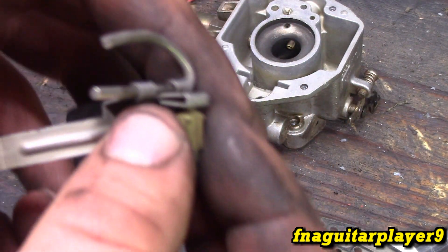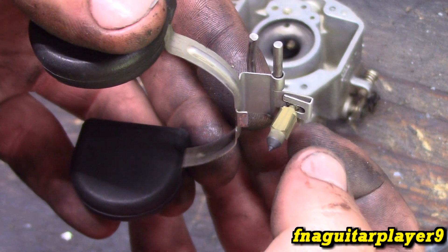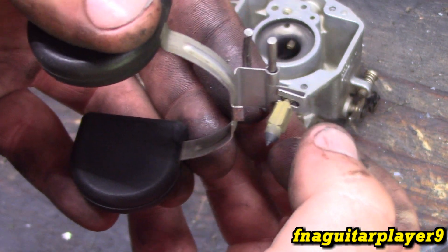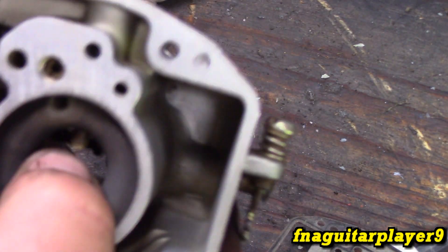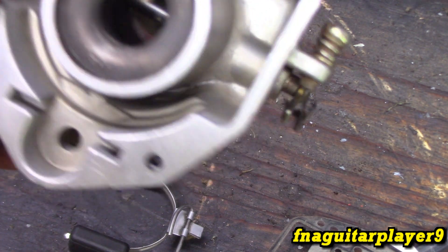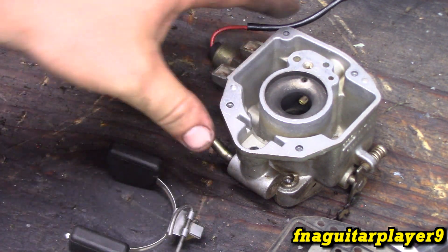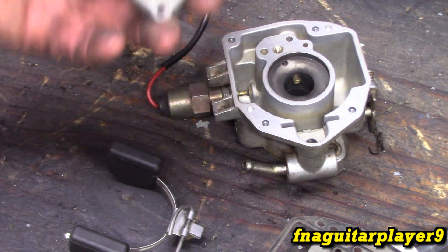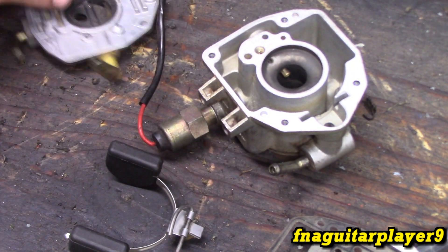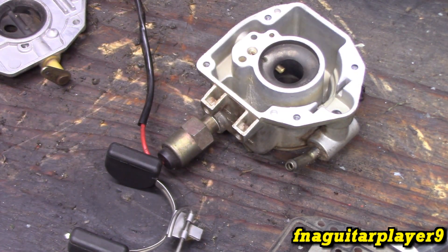This is more like a vehicle-style float, like you'd see in a larger vehicle carburetor. This is where your needle valve is - you can actually adjust the float level by bending this tab that the needle valve slides into, so it's fully adjustable. The bowl of the carburetor is actually in really good condition. You can clean most of this without taking the carburetor off the engine since you can get to all of it with the carburetor still bolted on. I always recommend taking the top piece off first because it gives you access to the jet and tube.